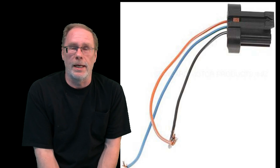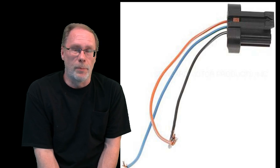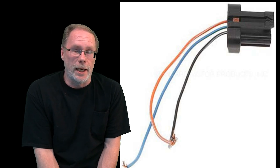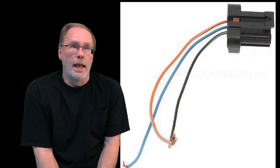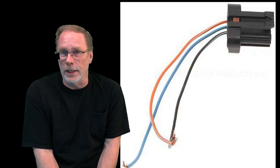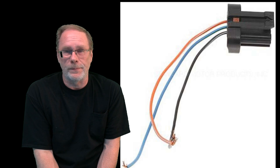So after that, let's check the wires and the connectors. Are the wires connected properly to the plug? Have they been bent for some time? Are they making the connection? Are the wires cracked? These are the things that we need to follow up through the motor, and also make sure the connection is clean, that it hasn't eroded over time or has debris on it, or whatever the case may be.